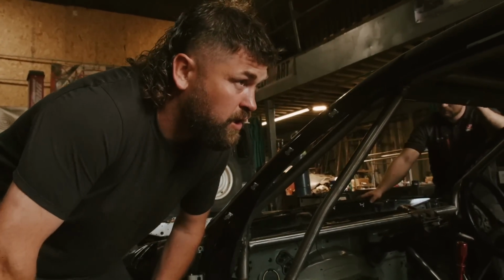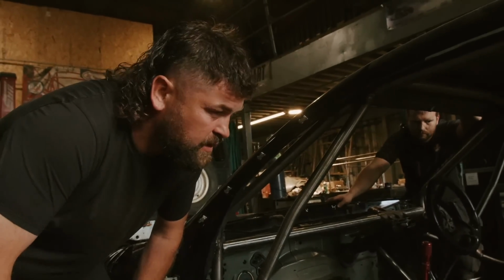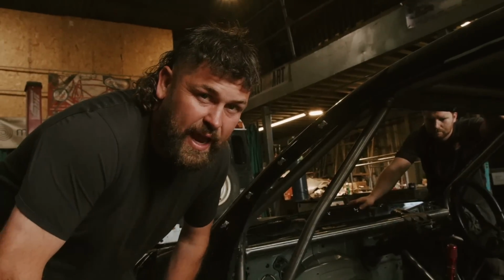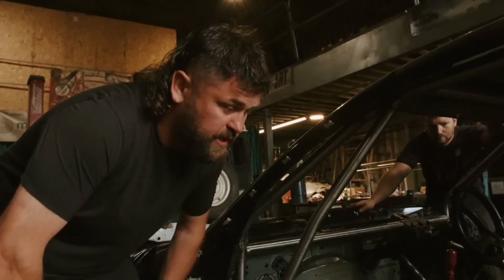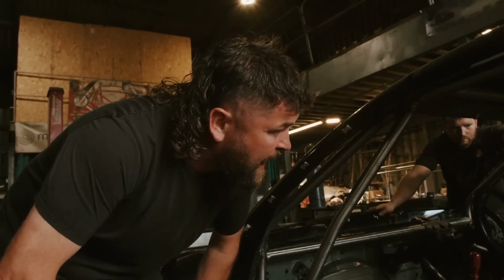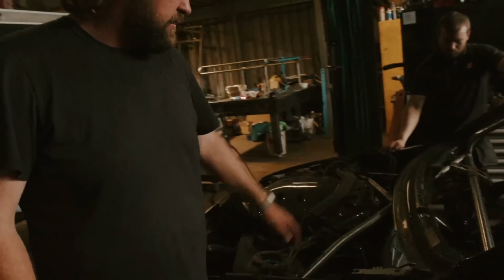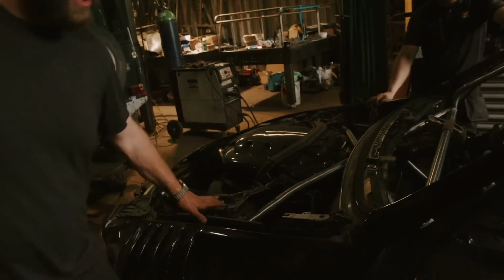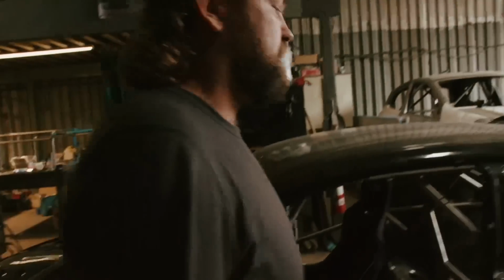It's definitely like a climbing frame. It's got tubes everywhere. We basically opted for everything. We didn't really leave any options out. Yeah, it's fully roll cage, fully welded in, T45, with almost every single tube option you can have. So the tubes come from the roll cage all the way through the bulkhead to the front turrets. On the sides here as well, you can see over there, connecting the front turret to the roll cage to the main hoop, and then the same on the back.